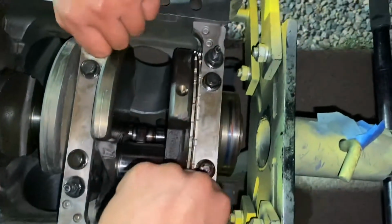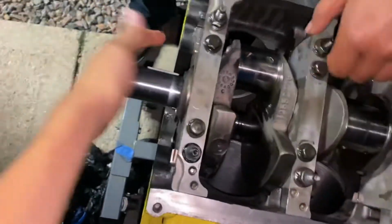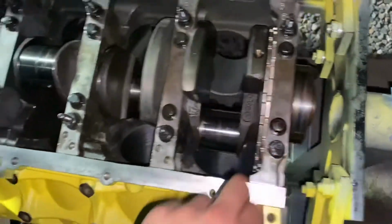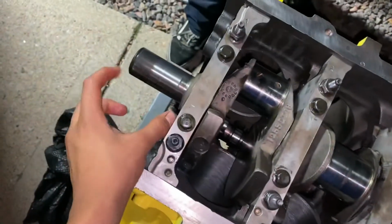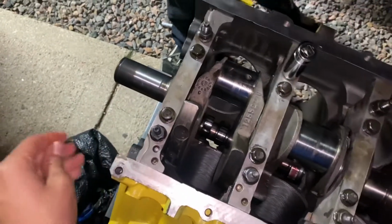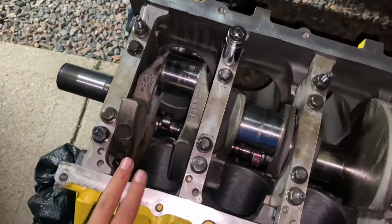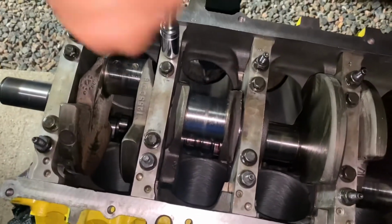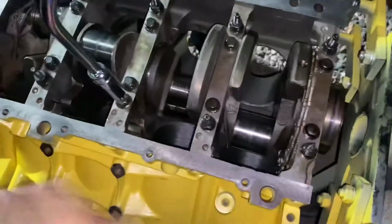And then after you make sure they are loose, you're gonna set your thrust bearing. What you're gonna do is hit it with the rubber mallet twice in the front and twice in the back as best as you can. And then you can use a little digital gauge tool in the front. But we've read that usually an LS never gets out of its thrust clearances. So we're just gonna send it and hit it backwards twice and forward twice, and then torque everything down from there.